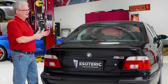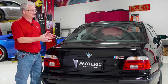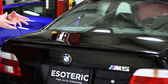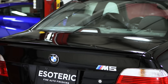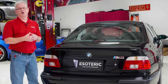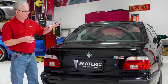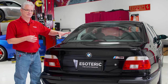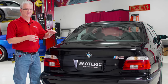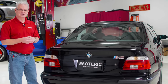Those are the kinds of things you want to really look for when you're taking measurements on a car. If you don't have a paint thickness gauge and you just start doing heavy polishing or compounding on a car like this, you're going to run into some severe problems. If you don't burn through while compounding, there's a good chance that if this car is outside, you'll start getting clear coat failure, cracking, peeling, fading. That's why you don't go in and sand OEM painted finishes. Watch out for areas that are really thin in particular, and adjust your process accordingly.